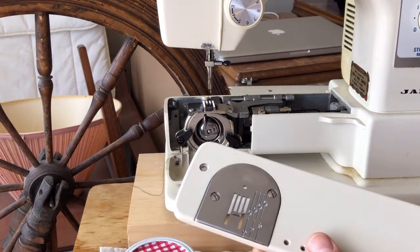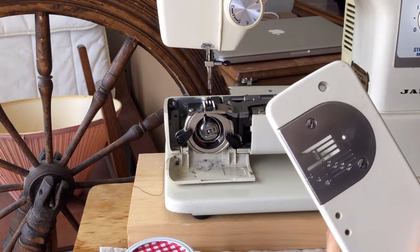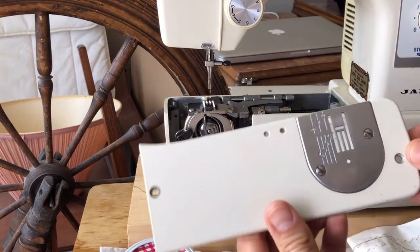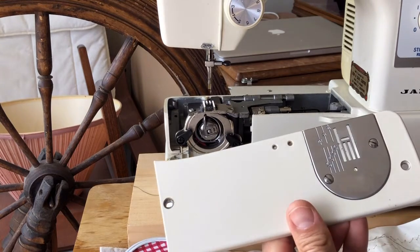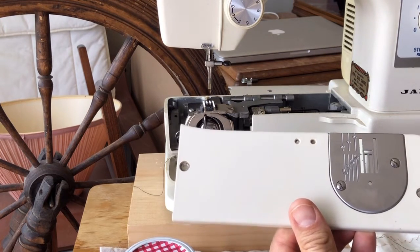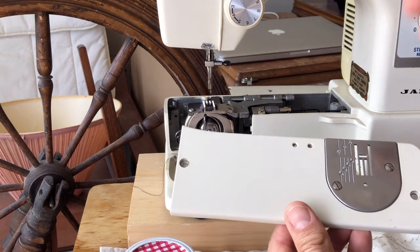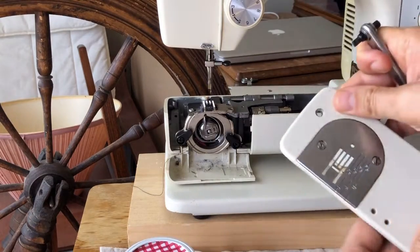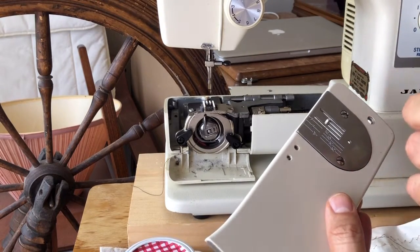The point is: don't damage those screws, and don't be in a hurry. If you're in a hurry restoring a sewing machine, you may not be happy with the results. You can do a little at a time — don't expect to sit down and restore the whole machine in an hour. I spend quite a few hours on machines and that's largely what I charge people for. I rarely have to charge for a part. Almost everything people pay me for is about getting things unstuck, adjusted, and cleaned. If parts are replaced, it's usually soft parts like a belt, a bobbin tire, or cords.